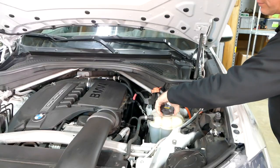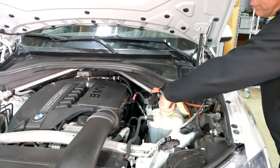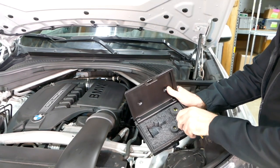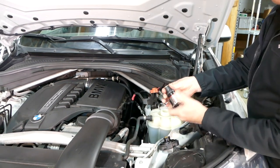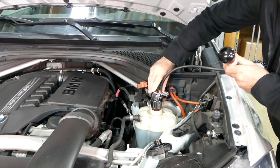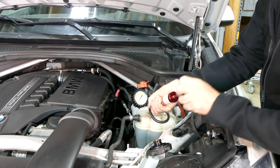Well I can do that. Remove coolant cap, completely wipe coolant residue, choose appropriate diameter expandable adapter — small, medium, or large — screw on adapter, tighten to seal, add pump, pressurize system.